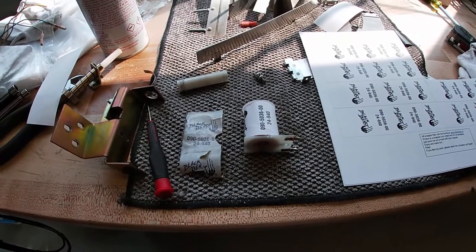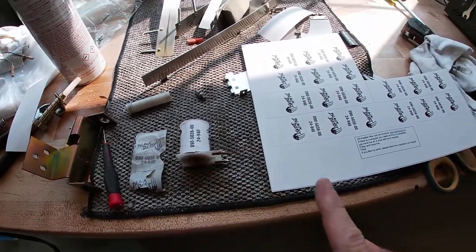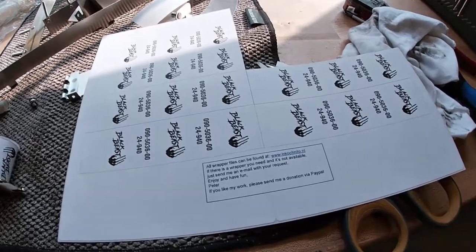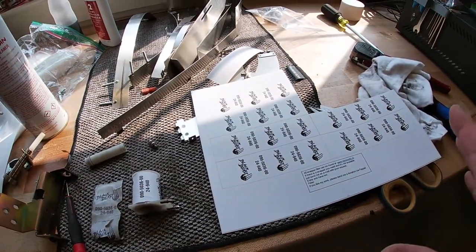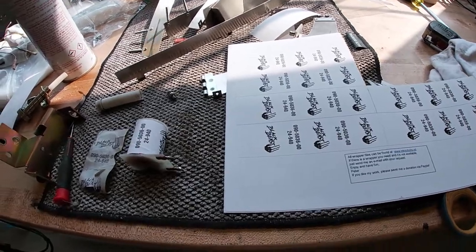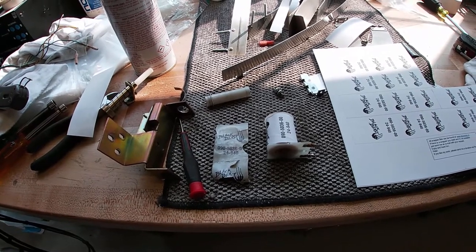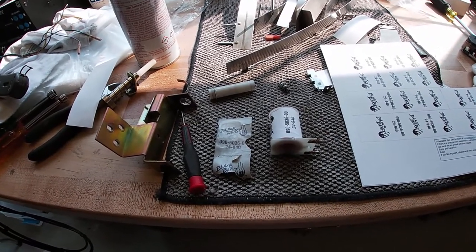One of the things I like to do when I do a complete restore is replace the coil wrappers on the coils. You can see this is the original coil wrapper and here's the one I've replaced. What you do is print them out — I use a shipping label, the privacy ones that are a little bit thicker so you can't see anything under the sticker. Here's the website where I get the coil wrappers. They have each of the numbers, and there's usually multiple coils on a machine that use the same wrapper. Just remember — your hands are probably dirty, so go wash your hands before you start touching this paper. Replacing the wrapper should be one of the last things you do when restoring a coil mechanism.